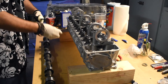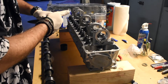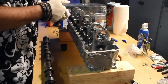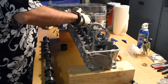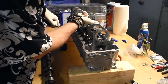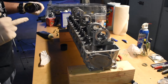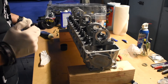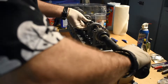Let's put the camshaft in — front side of the head is this way. Put some assembly lube on things. The front of the camshaft is marked with a little keyway, and the back usually has a hole or two. Some camshafts have this hollowed out, some don't, but it always has the markings on the back — at least the timing dots of the camshaft.